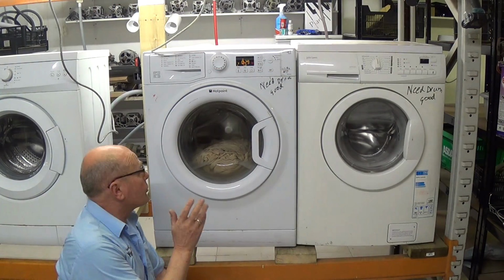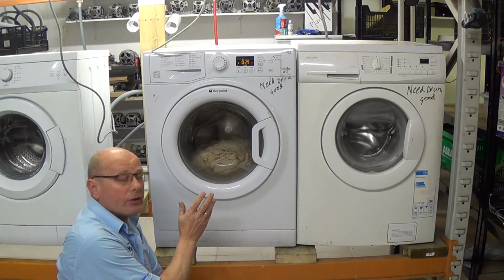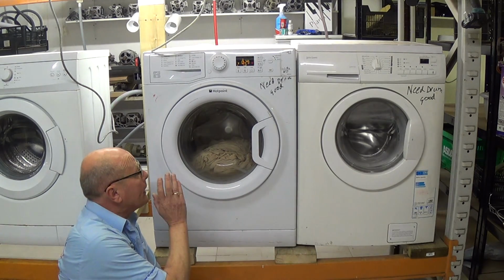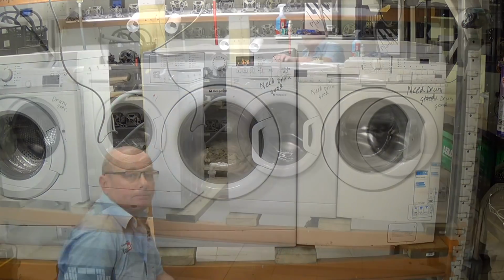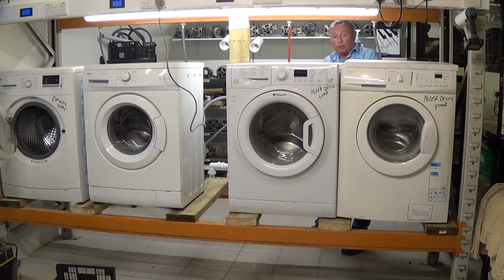As you can see on this machine, all the functional parts have been tested. I checked the machine's heating correctly, it's washing, drums rotating, so I know all the components on this machine are good apart from the drum itself. Right, the first thing we need to do with the machine is always disconnect it from the electricity supply. I'm going to remove the lid first, and I'm going to take off the door for you.